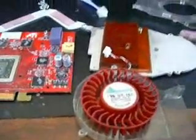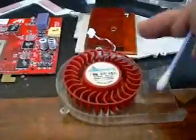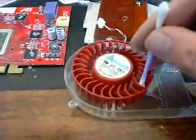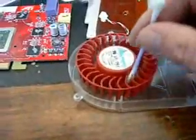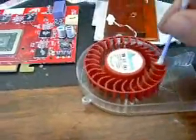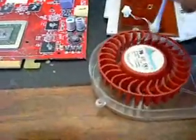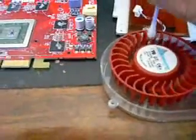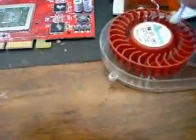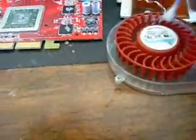One other thing I wanted to mention: in some of the tight spots, like in between these fan blades here where it's too small to get in with the toothbrush, you can use a Q-tip and get down in each and every one of these and clean them fan blades out good. Otherwise, if you leave any gunk in between any of them, it's going to throw the fan out of balance, which in turn will burn up the motor in it. And you'll just have a loud, noisy, hot video card.